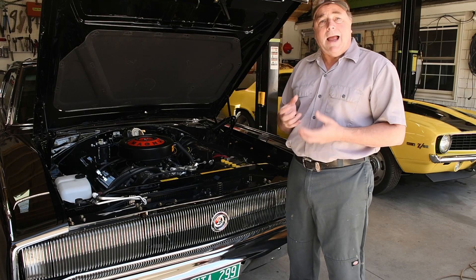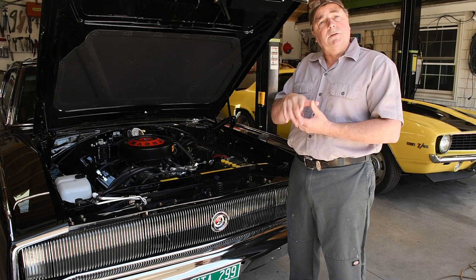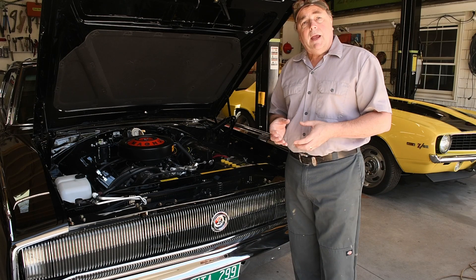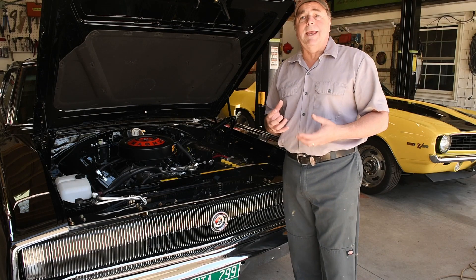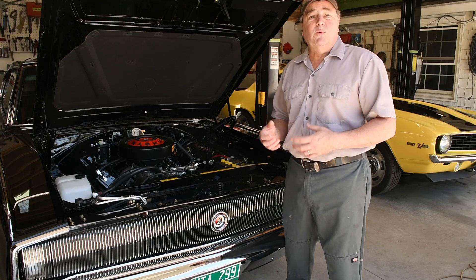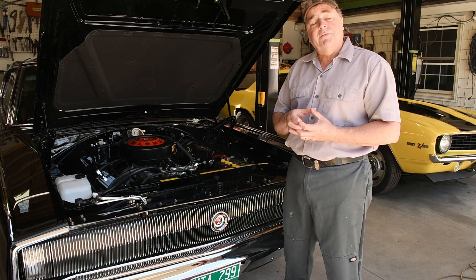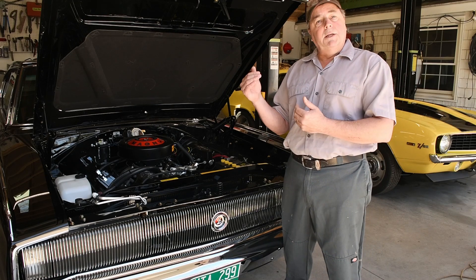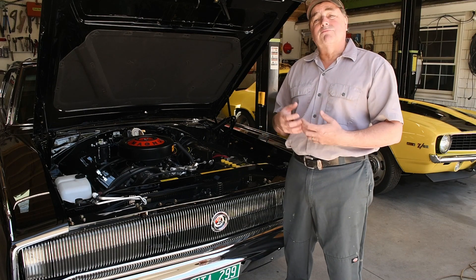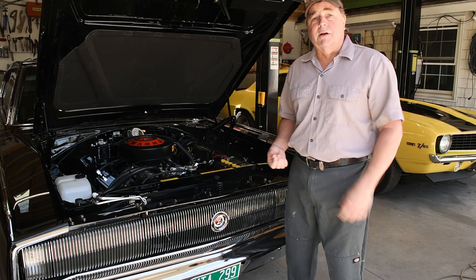I did a little research and purchased a vacuum pump — a piston-style vacuum pump — which uses an electric motor and a reciprocating piston, like a small engine, to create vacuum. The problem I had was when I installed it and tested the vacuum, I was only making about 18 inches, which is a huge improvement from 10 inches, but it was supposed to make 21 and never really got there. It also had a remote cutoff switch that was supposed to shut the pump off once it achieved 21 inches, so basically it never really shut off. When you turn the key on, the vacuum pump comes on and makes this rattly kind of sound, kind of like your father's Buick with the air ride in the back.